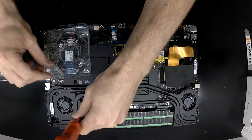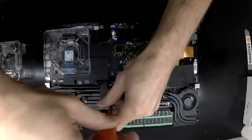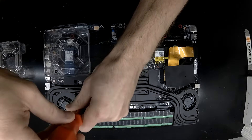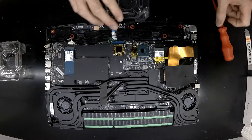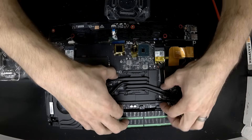Taking the bottom cover off, you do have to use a little bit of care. I try and open it at the opposite end to where the headphone jack and microphone jack are, just because the plastic goes all the way around them. If you try and pull it from that section you do risk damaging the main board.